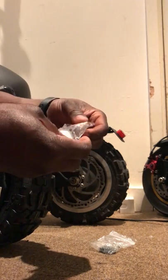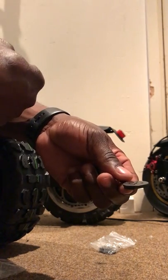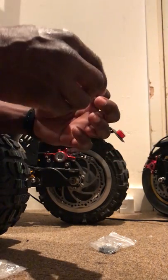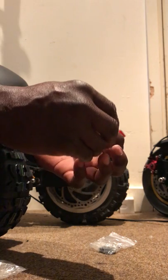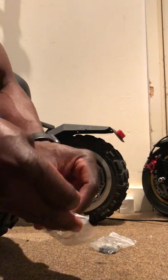This is what's going to be saving your life. So you've got the brake shoes here — they look like this. The only concern is whether this diameter will fit into the calipers. If not, I may need to take it to a metal shop to grind around it to reduce the diameter. As it stands I can't get parts from the main company — I think they've stopped producing this scooter. They also include a spring that goes in the middle: one brake shoe goes on one side of the caliper, the other on the other side, and the spring stays in the middle. When you brake, the hydraulic pushes them to clamp the disc; when you release, the spring pushes them apart so the wheel spins freely.